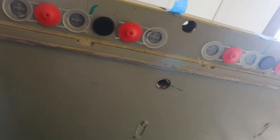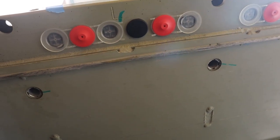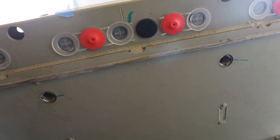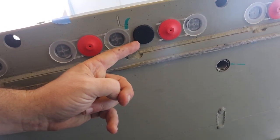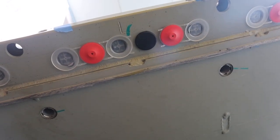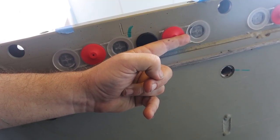Down under the sides of the battery pack we've got these umbrella valves, which I updated to the most recent style. In each section there are six: two umbrella valves, three plugs, and a Gore-Tex breather. I have that Gore-Tex breather temporarily replaced with just a one-inch silicone rubber plug, because those breathers would let air through — not water, but air. And if you can see right here on the wide shot, I can see it right up here — there's a little bit of O-ring sticking out.